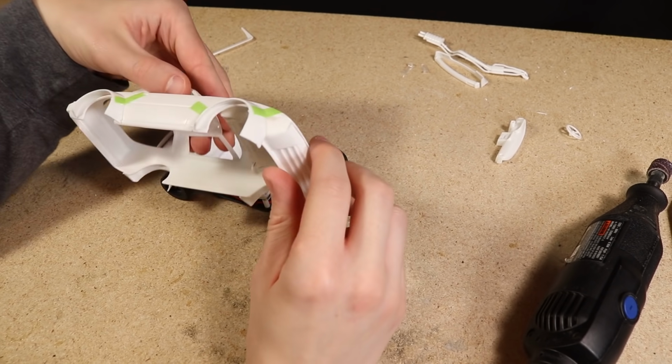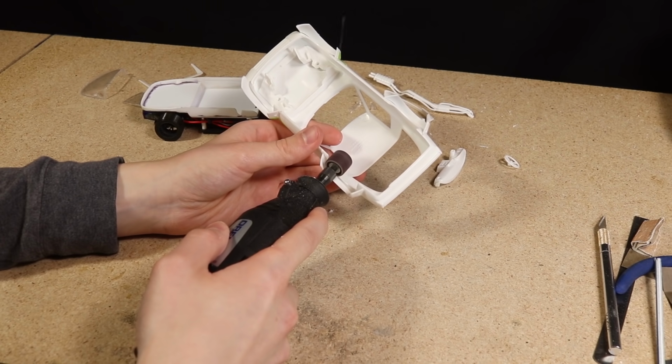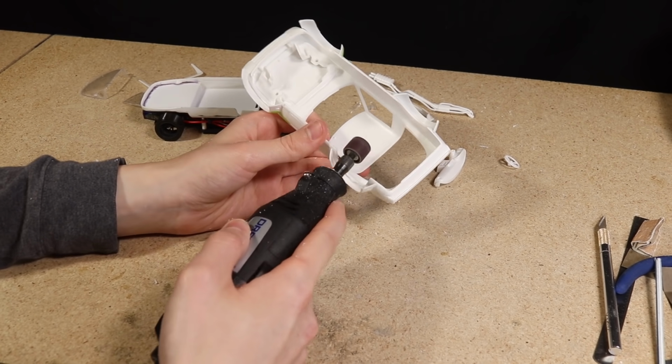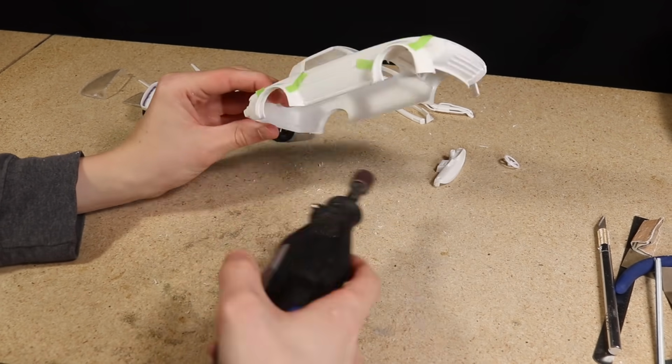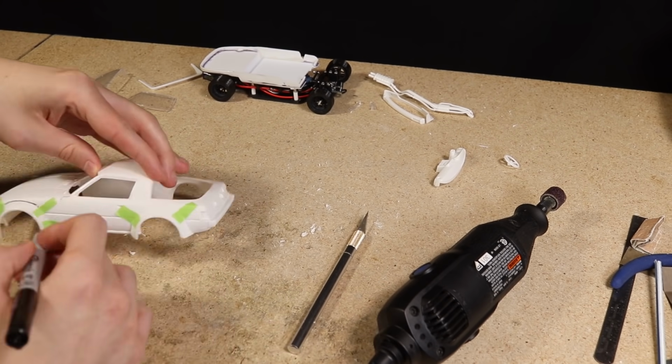Since the fender flares will be added, I wanted to widen all the wheel arches. This is partially cosmetic, but also necessary in the front, since the front wheels extend out pretty far from the knuckle and need room to turn left and right. I gradually removed more and more material, making sure I didn't remove too much.